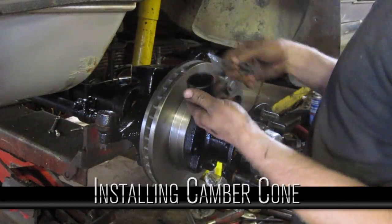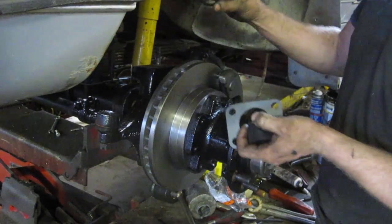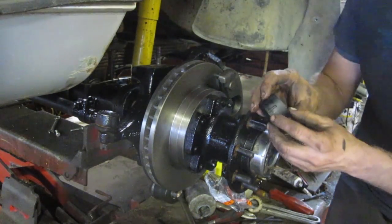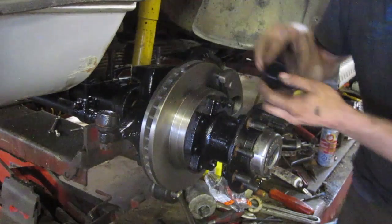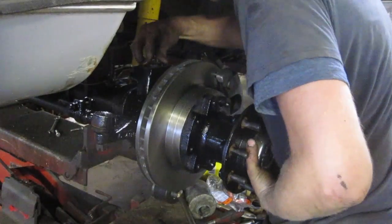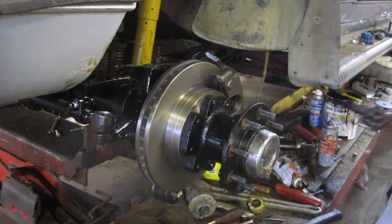I finally got me my little Teflon piece, my seal, and my gasket. Very simple, seal goes lip up, goes in the hole first. And then the Teflon piece with the knob fitting in the groove right here. Just gonna put some grease on it. Can't have too much grease. Gotta be 100% certain that it fits in the groove. There it is. Gasket around it. And we're golden.